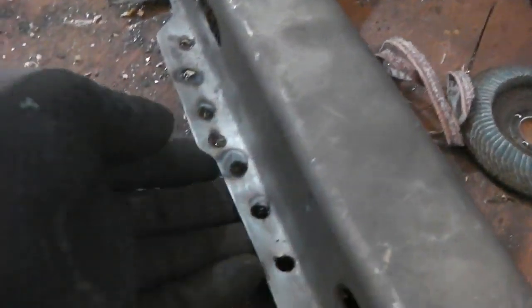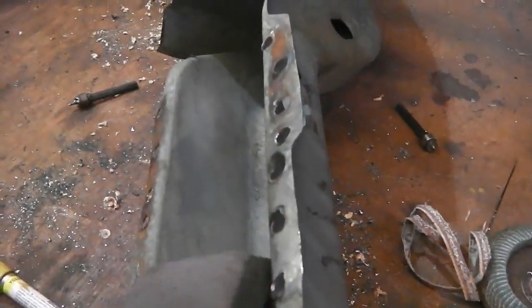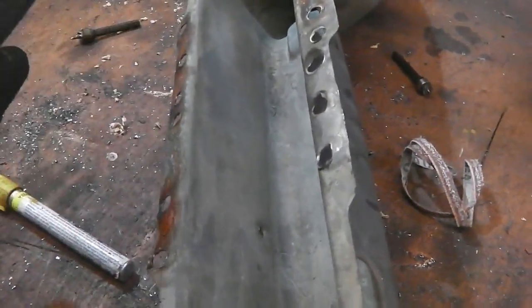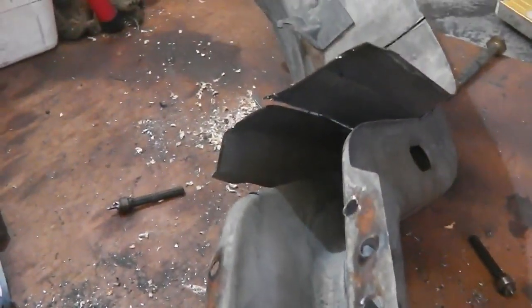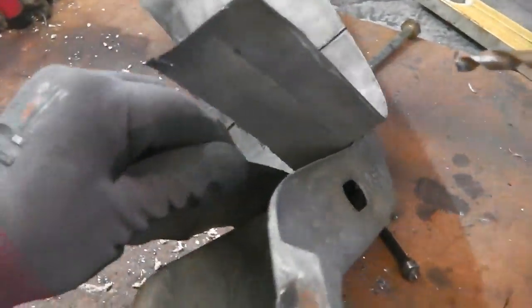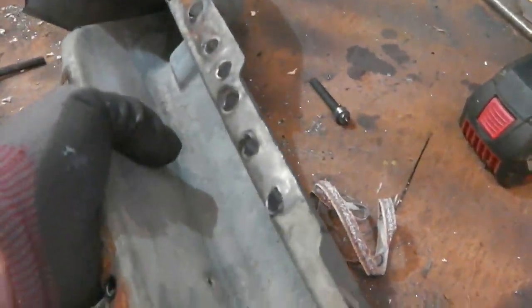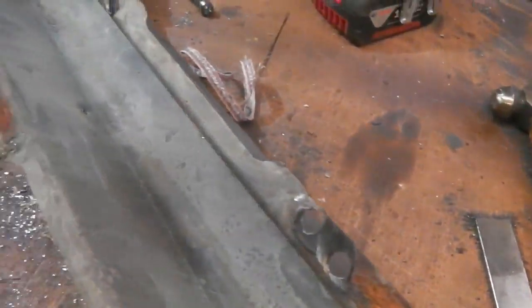Okay. And then what I'm doing, if they're not coming off easily, then what you can do is a great little technique. Remember this one now. Take note, everybody, because this will save you time if you're doing what I'm doing, which is loads of panel harvesting. Remember my little tip I told you about, first of all, about slitting metal. If you're not saving the metal, if it's discarded metal, which this is, make yourself some cuts because you can start to manoeuvre and break away and get in with a chisel if need be into the piece that you're saving. So I made a cut all the way down the middle of this, which meant that when the spot weld had weakened, you're able to rock and snap them.